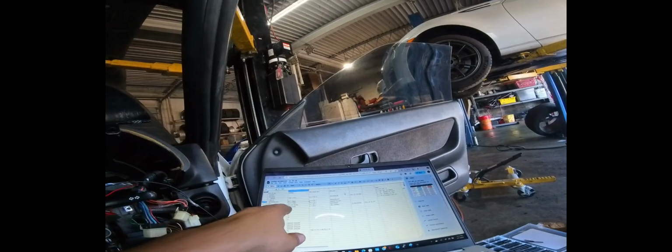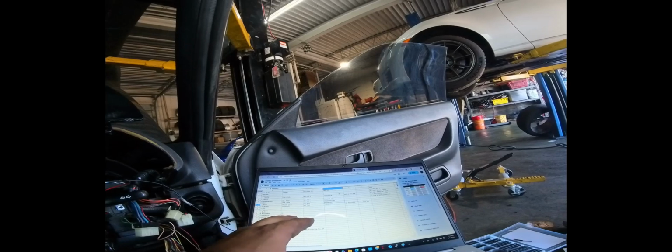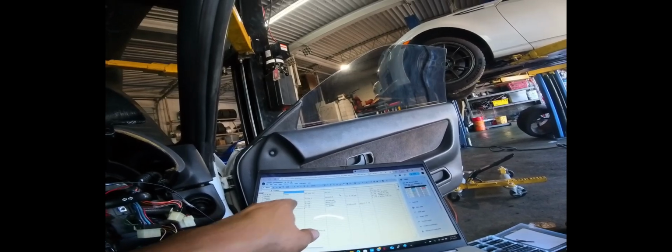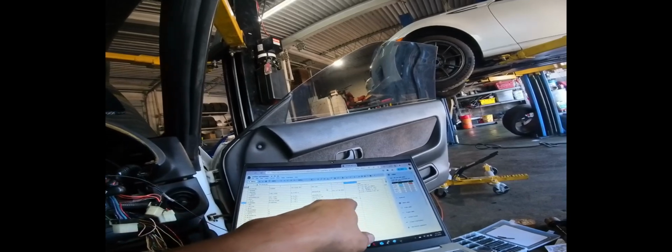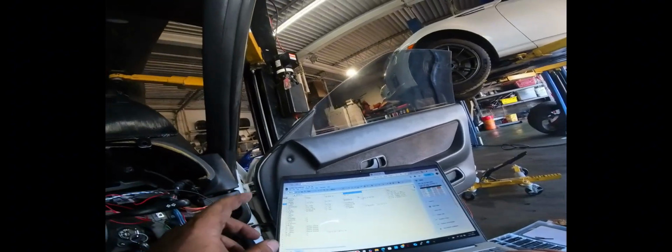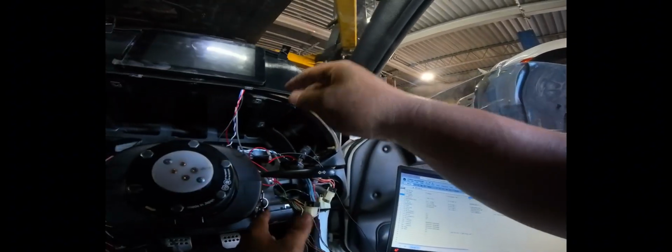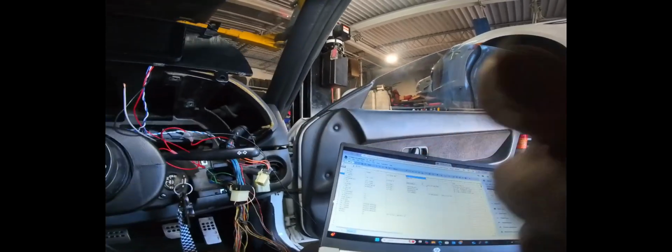So we're just going to start wiring up our basic functions here, which is going to be the left-right turn signal and the high beam for now. That's all we're going to wire up. Then we're on the e-brake. We're going to try to do a 12-volt pull-up, and I'll get to that when we get there. And then we also have to add another pull-up for the fuel level. So far the only thing that's been done is power, ground, CAN bus, and the power wire for the alternator. That's all been done.